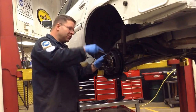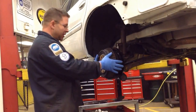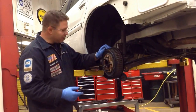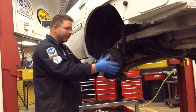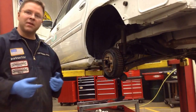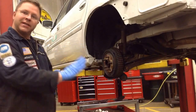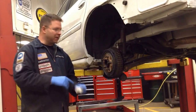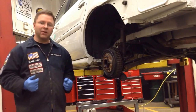By adjusting the rear shoes, that's also going to improve the brake pedal height and give you a lot better stopping power. As you're adjusting, put the drum on there — that right there feels really good. You'll notice I can't spin that drum freely like a wheel; it has some resistance on it, and that right there ought to be good. If we over-adjust the brakes, it's going to make them too tight and the brakes will be very grabby, and the back end of the car will actually pull down a little bit. So use your caliper — it's definitely a big help in adjusting rear brakes. That's the procedure for adjusting rear brakes on anything drum. Stick with it; I think you're going to get really good results.